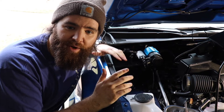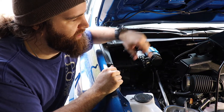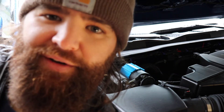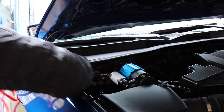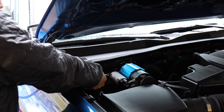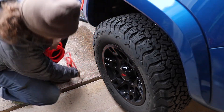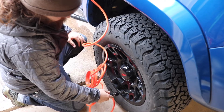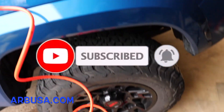I have the compressor wired in. Next I'm just going to snug it up and put our air box back, as well as run the wiring to the S-pod and the battery. It's all installed and ready to go. I wired it to the S-pod, turned it on, and the pressure cutoff switch works perfectly. I'm going to install our airline here — I took some air out of the tire so I'm just going to air up a little bit.